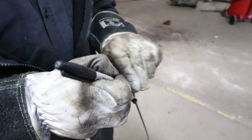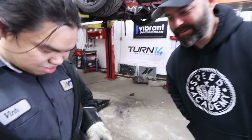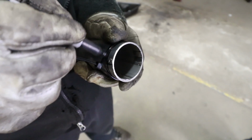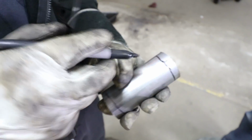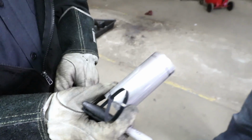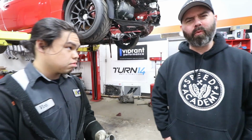I've seen zip tie tuning before, but never this type of zip tie tuning. This is impressive. Well, is this just so you can make a straight line? Pretty much. It's something I learned back in the war. Back in the war. It's a clever idea, actually. You find the lowest point on this side and the highest point on this side, and it'll help you make a straighter line for cutting and shaping purposes. With tubes, that's actually a really good idea. I'm going to build a roll cage now for Connie using the zip tie technique.